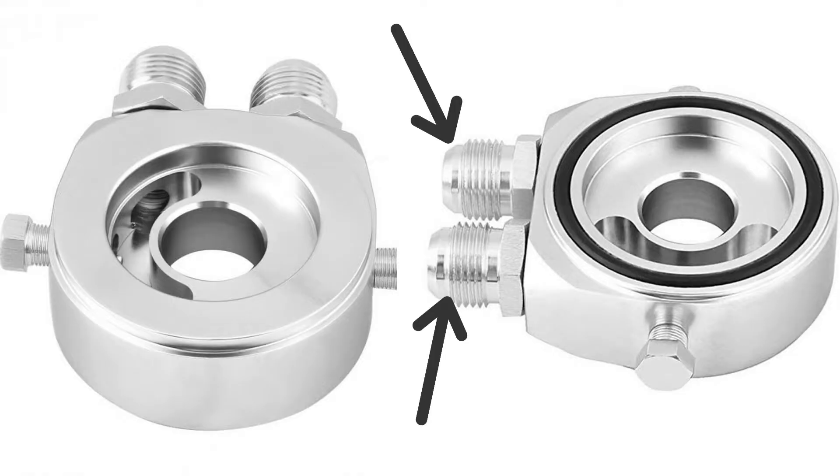The two ports on it had to be connected — I didn't know that, it wasn't in any instructions, it didn't say that anywhere. I should have taken a better look because oil can really only flow in and not out. I also should have believed my oil pressure gauge. I thought it went bad — the car sounds fine, it's still running — I just assumed that with zero oil pressure it would have died immediately, but it didn't. I'm trying to say: I'm an idiot. This will probably be the last post for a while.